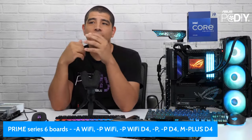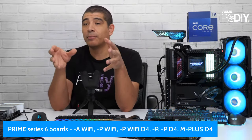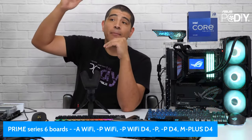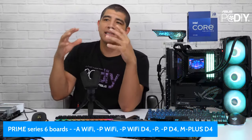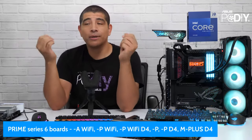1000 watt is more than enough because again, the 4090 series also has much better transient power performance than the 30 series, which means essentially it doesn't spike up as much in terms of the peak power draw than the 3090 series. So in that regard, it's actually more efficient and it's less stressful on the power supply. So 1600 watt, if that's what you want to run, it's more than enough.